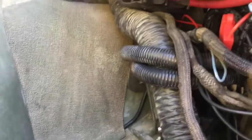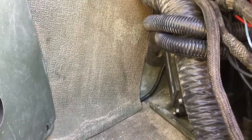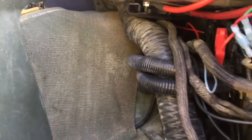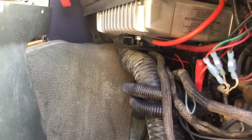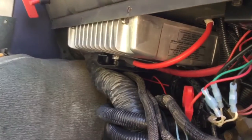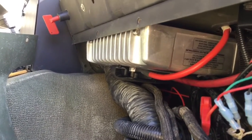I need to free up a little bit of cable length up in the dash. One of the cables to the VIM is really short and the other one's about three feet longer than it needs to be. So once I get a little more cable room I can tuck that in there a little bit neater under the wiring. But everything fits, the dash panel closes up, and the airline is still all good. This location is right along the pathway for DC power, so I really didn't have to wire too much out of my way to accommodate this change.